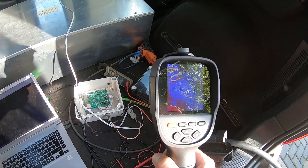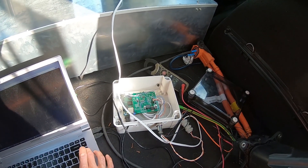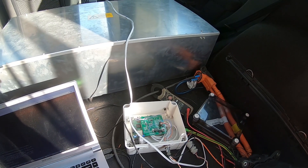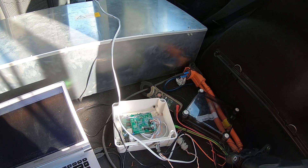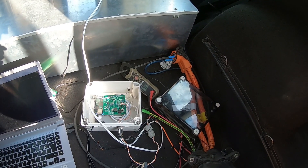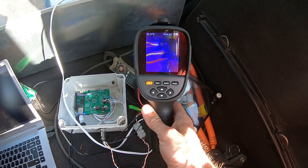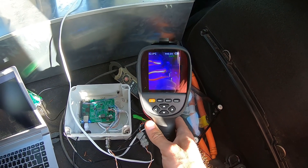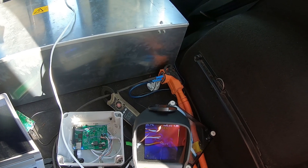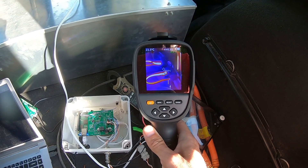Audi is also charging fine — there's never been a real issue. It does require some manual intervention from time to time because I'm gatewaying the charge limits from the BMS via Wi-Fi to CAN, and that can struggle to stay alive. I borrowed a thermal camera to watch the somewhat sketchy connector down there — it's just some 8-millimeter aluminium tubes stuck into the connector. As you can see, they do heat up: the lower ones are at 66 degrees Celsius.